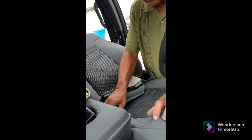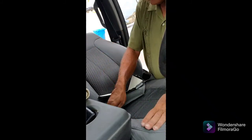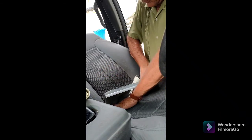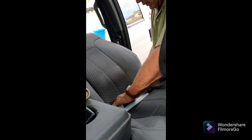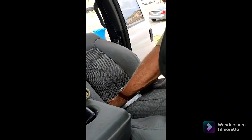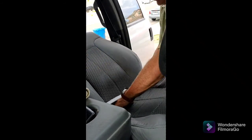So I got the inner seat, this band right here, clipped into those little clips. It's about what you'd expect. I think the trick there, if there is any, is to put them in one side and then roll them into the other side of that clip. Now I'm just tucking everything back to where I can get the clips that were underneath the seat attached.